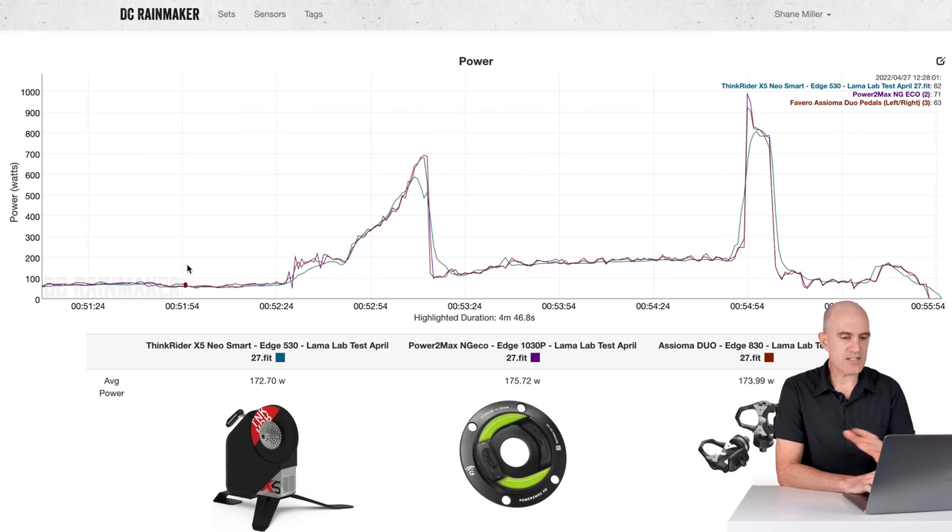The final section was a slow ramp test and a hill jam. Just riding along under 100 watts, things look okay. I slowly ramp up — the X5 is a little slower to respond, then starts to play ball with the two other meters up to 400 watts, then over-reads, then under-reads, then over-reads again. Not that impressive pushing 600 plus watts through the ramp. If you were racing on Zwift or any other eSports platform, you'd be robbed of a few watts there. Then riding along at around 200 watts — not too bad, probably reading just a little low. And into a hill jam where I accelerate quickly — not an all-out sprint, more like an acceleration on a small climb — it didn't quite capture the peak power of one or two pedal strokes, taking a little while to come up to meet the other two power meters.